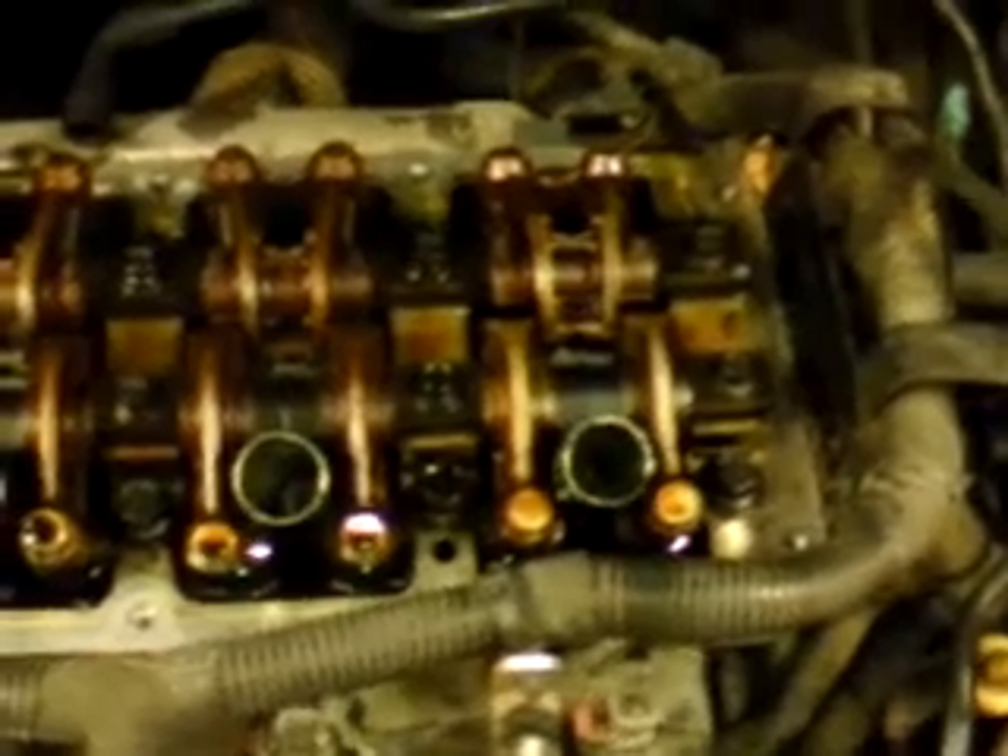I've already unscrewed this. The next thing we're going to do to diagnose this is to unbolt the rockers — you can see the bolts here and right on down the line all the way across and on both sides. Taking the rockers off should allow the valves to fully seat in the head. Then we're going to do a cylinder leakage test to see if we are losing air out the intake valves, the exhaust valves, or past the piston.